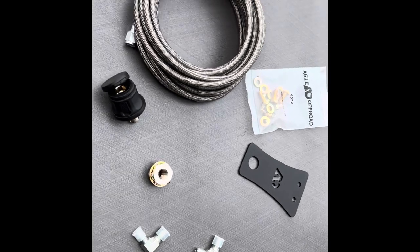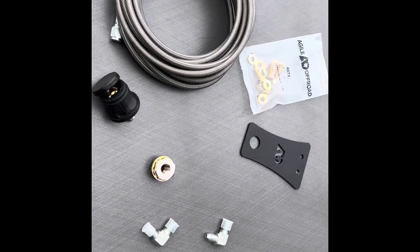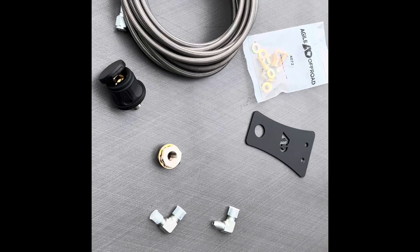I will be timing this to give you some perspective on how long it might take. Here's a look at the hose that Jayco installs in these vans — it's only rated at 150 degrees, and these ARB air compressors put out what I'm told is 190 to 200 degrees at the compressor. That's why we're having a failure and why we need to install this kit.